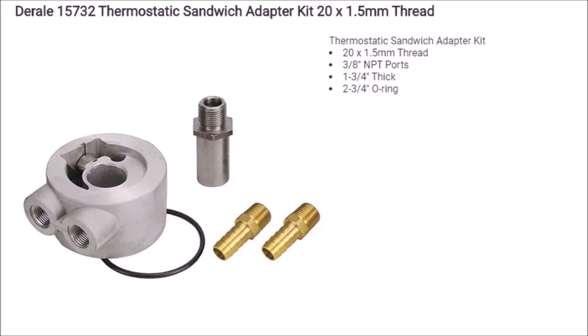The one on your stock car is tall to accommodate the factory oil cooler. What Poor Man Mods figured out is that because of the little rectangle area where the thermostatic plate opens and closes, the regular 350z size oil filter is just slightly too small — those two little corners are exposed and oil will go everywhere if you try to start the car with a regular filter. You're going to have to run a different filter.